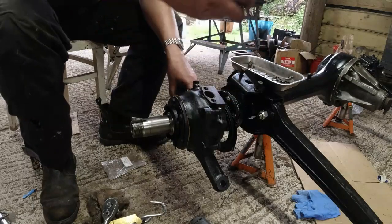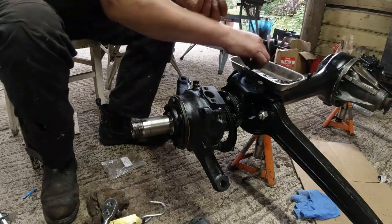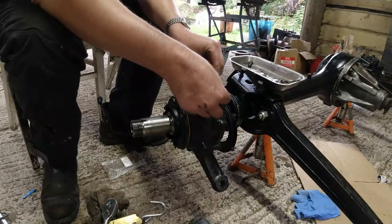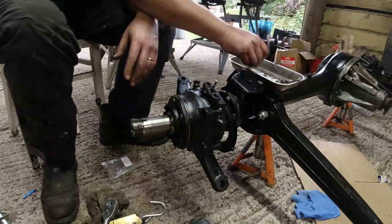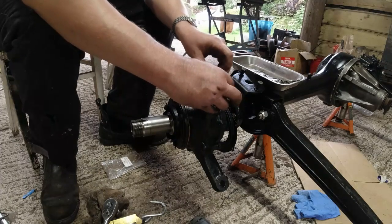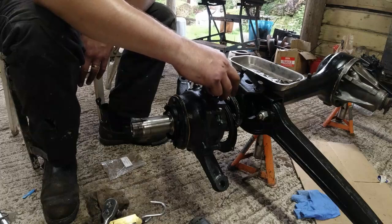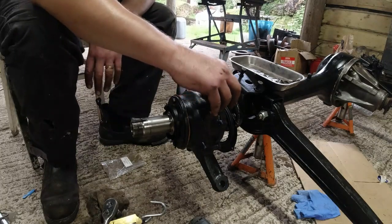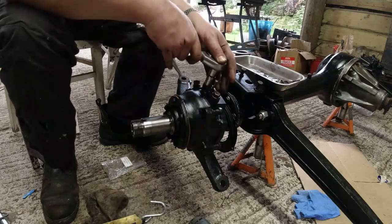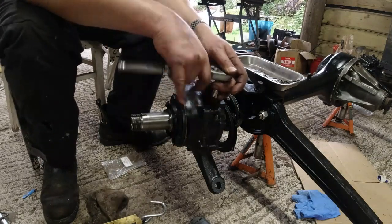I need to make sure I retain the shims I've already put in there. So we'll put just a couple of shims on — it's the bottom two that have gone back on again. If we're now stupidly small, then I need to take one of those out and fiddle around with it that way. Sometimes you have to get down to using a micrometer to work out the overall thickness, otherwise it just ends up being complete guesswork, and you don't want that. No one needs guesswork in their lives. But once this is done, I can assemble the sweep seal and start to build up the hubs. The hubs still need painting on this, so I've not done that yet.